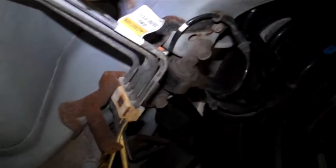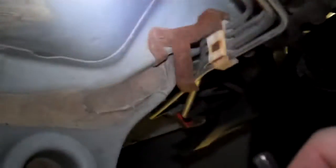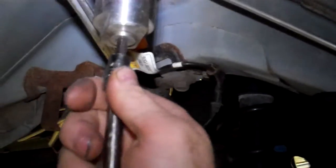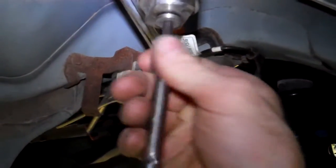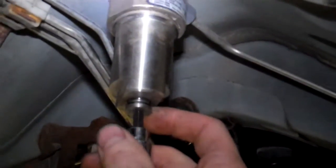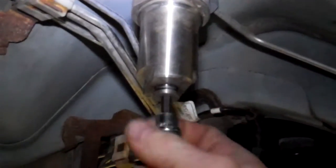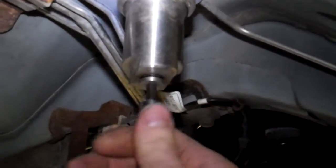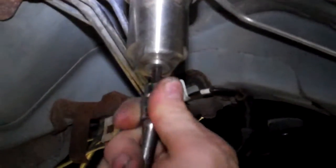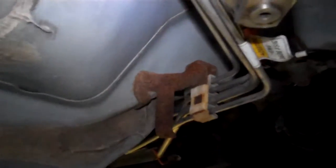The next thing you want to do is pull the drain for any water or oil that gets into it. You want to take a 6mm Allen and unscrew this. As you pull that out, it will let out any kind of water, residual pressure, etc. And you'll be in good shape as far as that goes. Then put it back in. Watch the O-ring, make sure it seats properly. If you don't run the vehicle out of gas and you pull this first, it'll spit the O-ring out — it'll go pop! And it'll hiss and it's kind of scary.